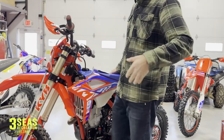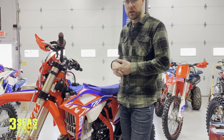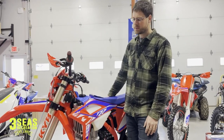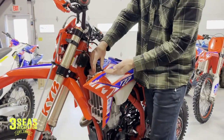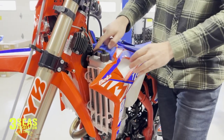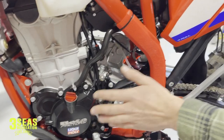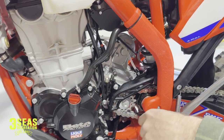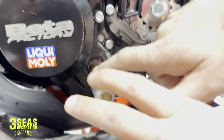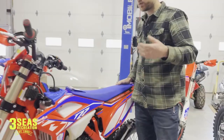On these bikes, I've noticed from phone calls around the country that people's oil level isn't where they want it to be. If you notice the oil is not where it should be, I'd just flush it — totally drain all the oil and put the right amount back in, so you know exactly what your new bike has in it. The coolant is easy to check: spin the cap off and you want the coolant level just above the fins in the radiator. You can't have the coolant all the way to the bottom of the filler neck — that'll create too much pressure and blow it out the overflow tube. Keep in mind four strokes are a split case design: engine oil is on this side, transmission oil is on the other side, and you have the sight glass. The sight glass will show too much oil until you ride the bike, and then when running it'll show right in the middle. Follow the manual and check your oil — you have to do that on a brand new bike.